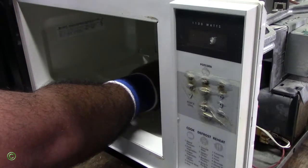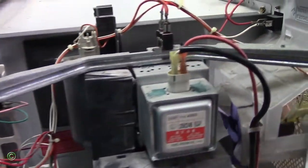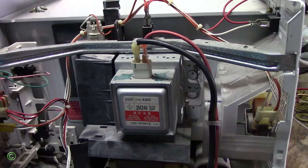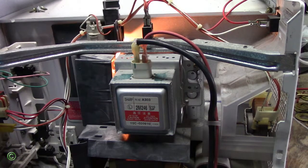Simple as that. Put the water back, close the microwave, and run it for a few seconds and you will see the difference. There's no spark, there's no loud noise, there's no bad smell. Running it now. So you see it running — so far there's no spark, no loud noise, nothing smelling bad, nothing smelling like it's burning. So you see, this was the problem.